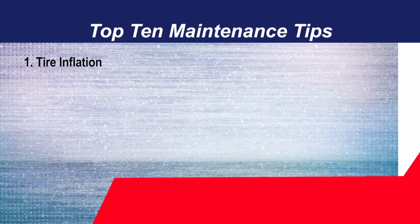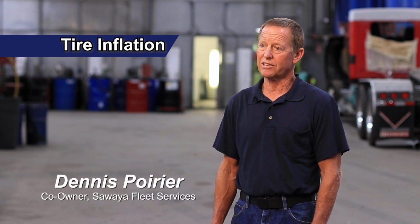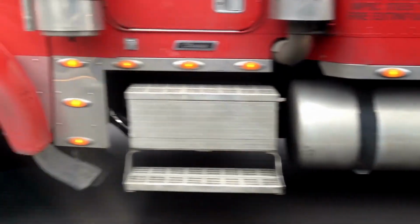Well, that's pretty important, especially in the summer. What happens is if that tire's low and you're running 80,000 pounds and you've got one that's, say, 60 pounds and the other's at 100, that tire's gonna heat more than the one at 100, and then you've got big problems, especially if you're running caps. You see a lot of recaps all over the highway.